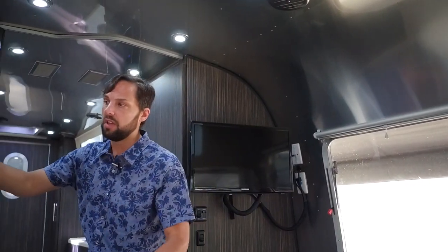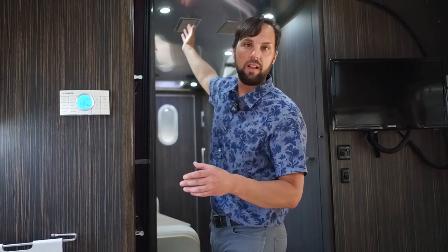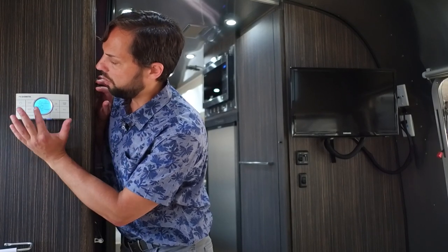Also in the bedroom is the comfort control center — the thermostat for the HVAC system. Once you turn it on you can toggle through modes: Cool runs the AC, I have it set to 68 degrees but you can adjust it. Fan speed can be set to low, medium, or high, or auto — on low/medium/high the fan runs continuously while the compressor kicks on and off as needed. On automatic, the fan shuts off until cooling is needed. There's an automatic mode that runs either AC or heat pump depending on conditions — useful for mountain camping where it's hot by day and cold at night. Heat pump works by reverse-cycling the AC and works when it's 45 degrees outside or above. Below that temperature, it automatically kicks on the 18,000 BTU furnace.